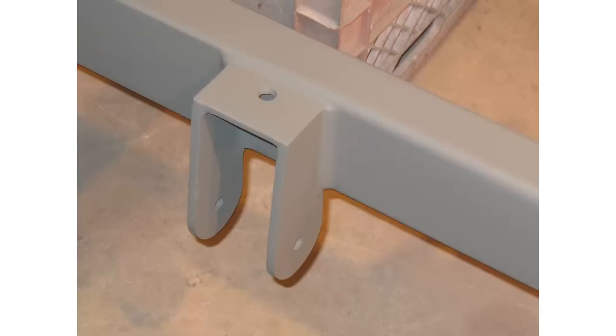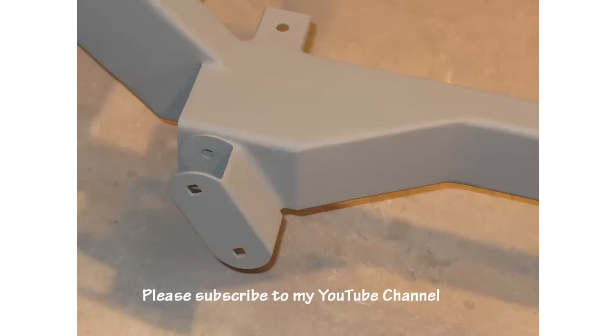This is a picture of the mounting bracket for the rear end. At the top of this bracket I've also included a hole so that I can have an additional body mount, as I needed to get creative and I had to remove much of the floor in the rear of the body and cross members. This rear control arm mount was made from 2-inch square tubing.